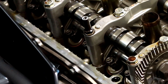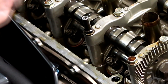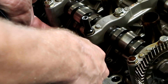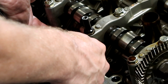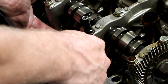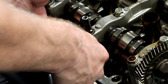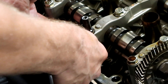I adjusted this valve and it's by feel. A lot of people ask: how do you adjust the valves, how do you set it, how do you know it's too tight? You do this by feel. Make sure the feeler gauge is in there perfectly straight and it should just drag. As it pushes back and forth it pushes the oil out between the surfaces, gets a dry surface, and that is the perfect feel. Not a lot of pressure, not a lot of force — and when you pull the feeler gauge out you're not hearing it snap, but you're hearing it drag. That is the right feel.